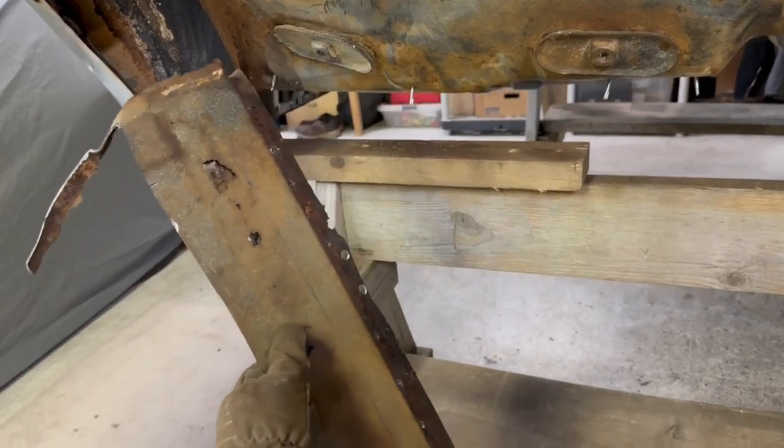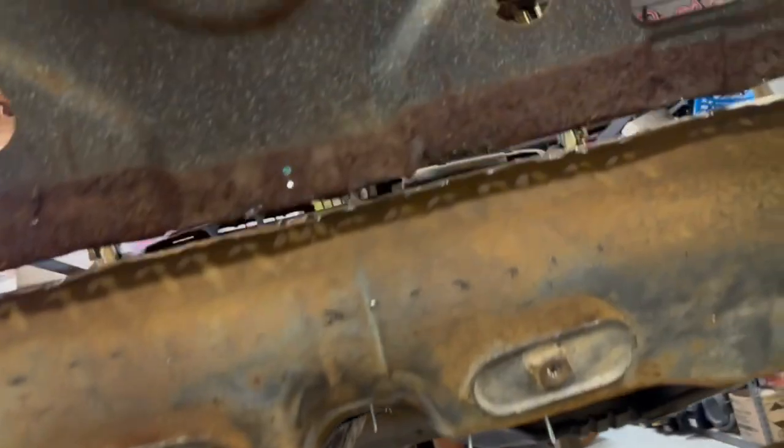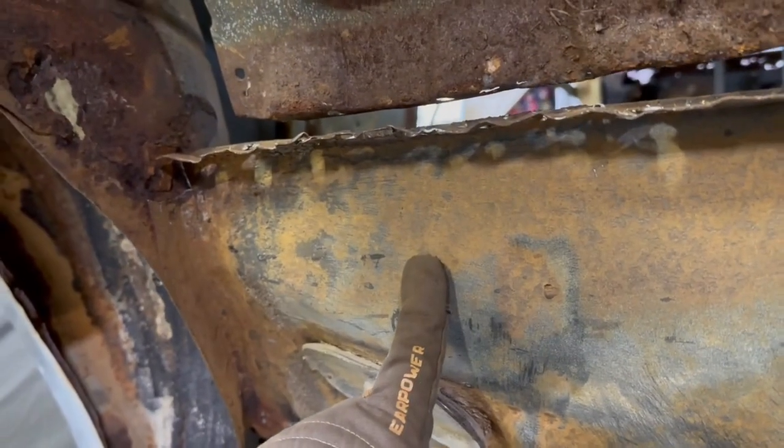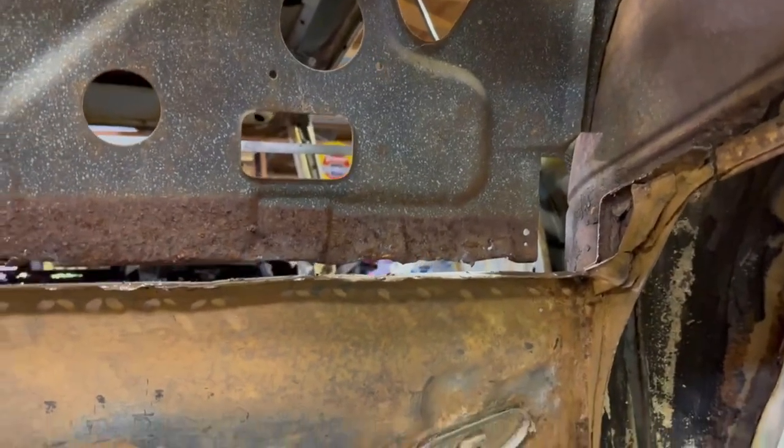Here's what got accomplished today: I took out the front trunk floor support. It goes between the rear seat pan and the back of the rear seat panel — it sandwiches between these pieces. I think I counted 32 or 33 spot welds along the bottom of the rear seat floor pan. I really want the new trunk floor pan to go where it originally went. This is all I have holding the original car together, the back part of the rear seat floor and the upper rear seat — the rest of it is pretty weak.